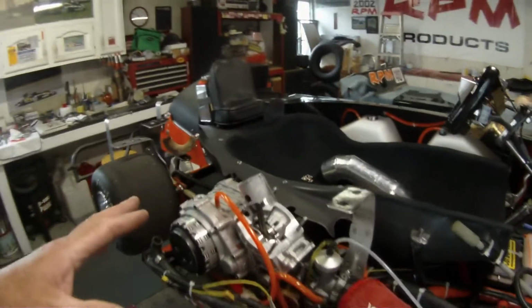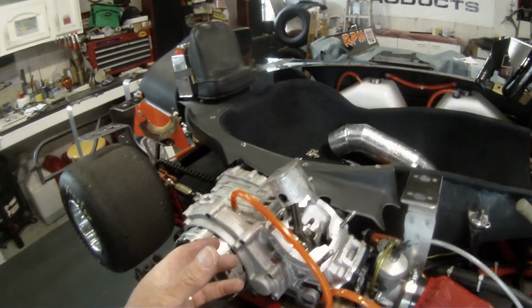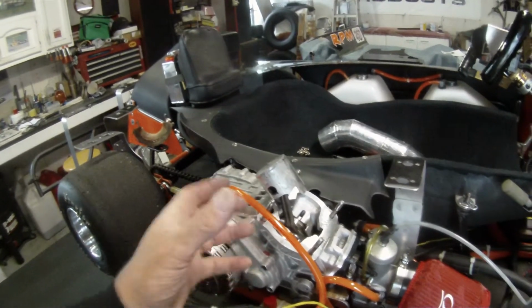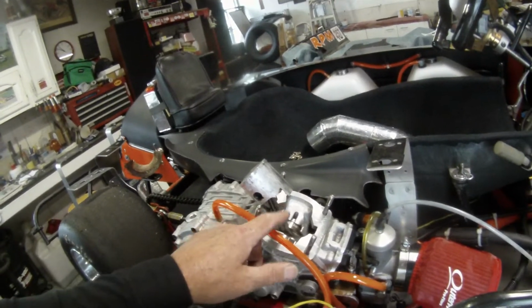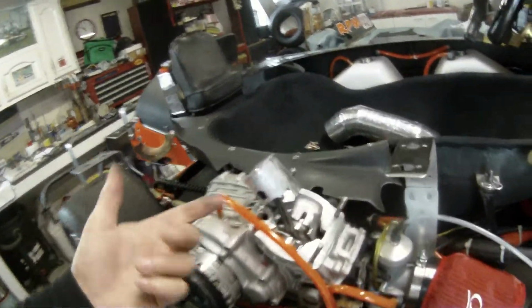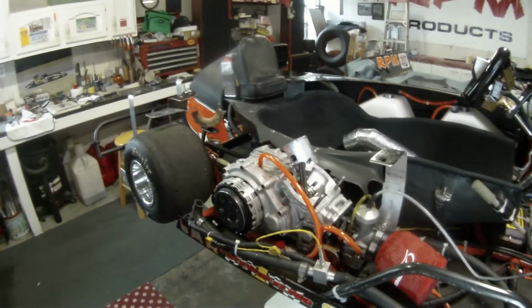I think what happened was we put a piston in, and we're going to find out exactly for sure, but I think it was too big for the hole, not enough clearance. As soon as it got to 140-some odd degrees of water, the skirt, being the biggest part, expanded first and maybe even started to stick. Then maybe I broke this off as I let the clutch out and grabbed it again, thinking I was in neutral, or it was sticking and breaking at the same time. I don't know.